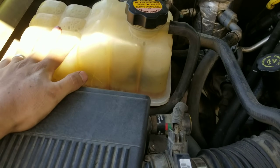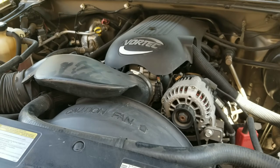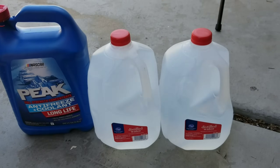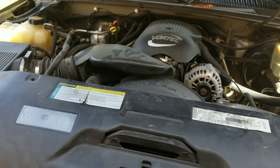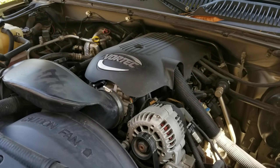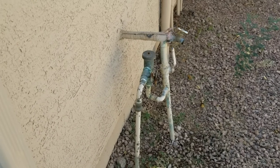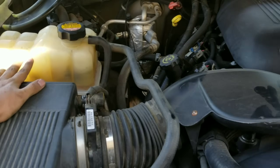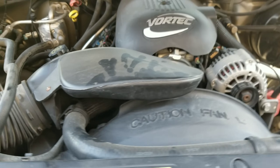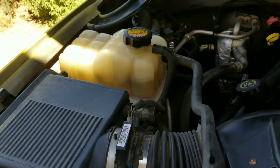Before you can do this, you have to first drain out all the red coolant so there are no issues with the mixture. It's very important to use distilled water — if you use tap water, your cooling system is going to get rusty from the minerals. It's okay to use a hose with tap water to flush the system, but don't leave it in there too long or it will build up minerals and rust the engine.